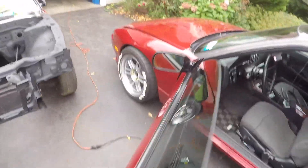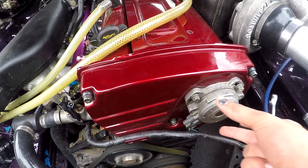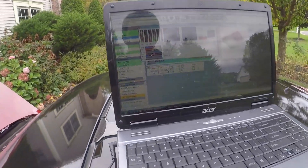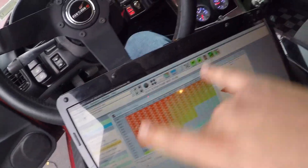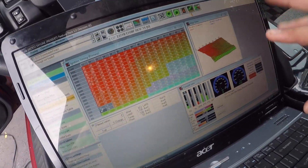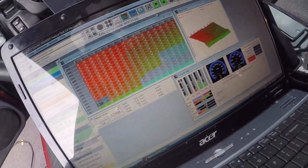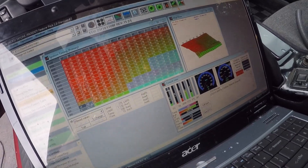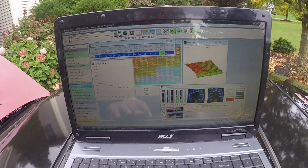How I know how to do the timing is you pop the hood, go to the old cam angle sensor — right here — and spinning this left or right should basically adjust timing. So I'm going to go ahead and get myself a 10mm. We turned it a little bit. Still reading 10. Quick update: I believe it's because I didn't have my AAC valve connected in Nistune — I didn't have that box checked. RBs run off AAC and coolant temp for ignition timing. I got it back, that's all that matters. I'm also going to adjust my TPS just a hair so it reads 0.5 volts. We'll burn everything and make sure we're good.